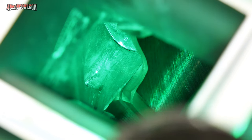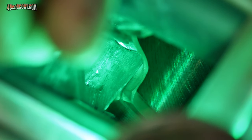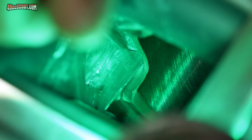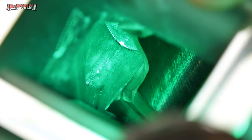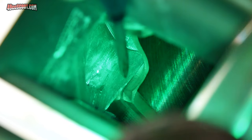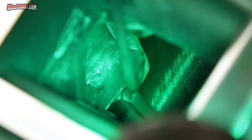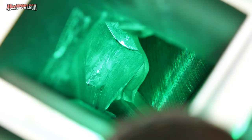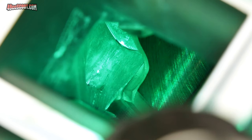So you may have to excuse the flashlight a little bit, but you can see way down here that the top part I'm touching right now is the cylinder. You can see the base gasket there, and then these are the cases. So if you have your reed block out, you can actually look down there and see where everything is. It would be possible to take something like this pick and move this stuff around a little bit, or when the cylinder's not totally tight, you can move that around if you need to, but you can achieve a pretty good match.